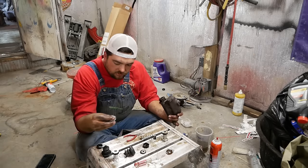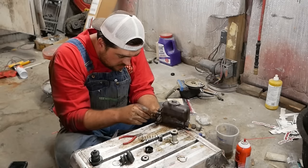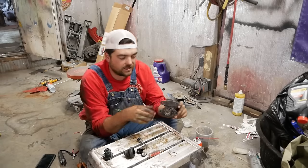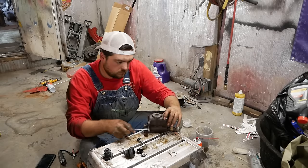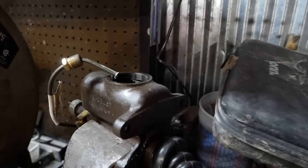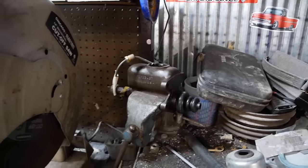Install our new spring, put our new seal in, put our new piston in, put tension on it, put the washer back in — it's definitely a snug fit. At last! Now we'll bench bleed it again. Seems like it works — let's see what happens. It actually looks pretty good. I don't want to get too excited, but it seems like good pressure. I think that thing is actually functioning.